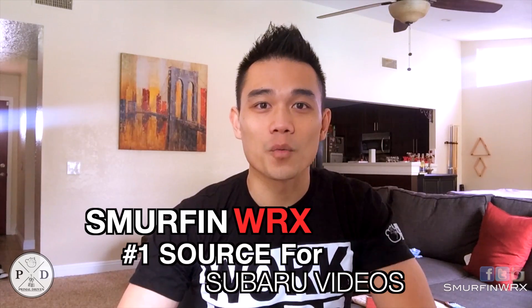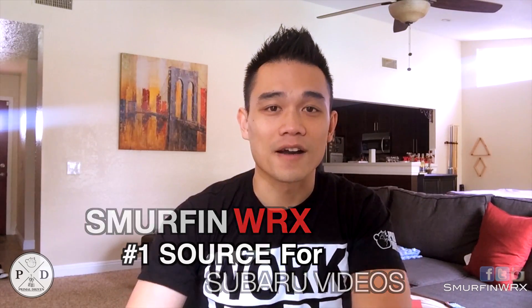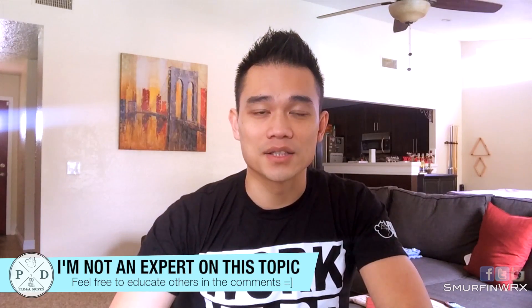So the big question is, what is ring land failure? A lot of people have been talking about this because it's very prominent in the Subaru community between the years of 2008 all the way up to my car, 12s, 13s, and probably the 14s now too. Ring land is basically the rings around a piston, and the failure comes from cracking and eventually corrosion of the rings. This can be very bad for your car because you lose a lot of compression, which means your car doesn't accelerate very well and it causes a lot of internal issues.